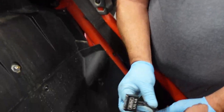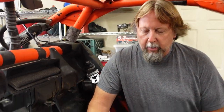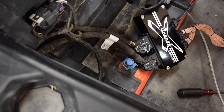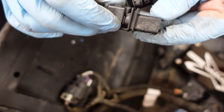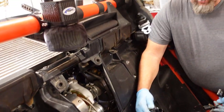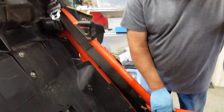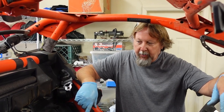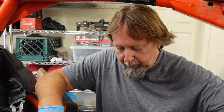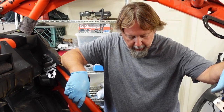And then here's my lambda — this is where we get our closed loop. This is my O2 sensor, which now you can buy at any AutoZone or parts store. There's something written on the other side — looks like it's scribed on there. So supposedly I'm going to plug this in — you can only go one way. So we've got that plugged in, we've got the new O2 sensor, the 4-bar MAP sensor, and I changed the plugs. These are not grounded off of here obviously because they're screwed into plastic, so there's no issue there — nothing to grab on the ground, it's supposed to be internal.